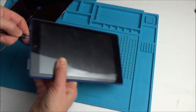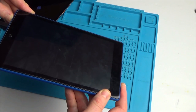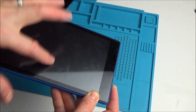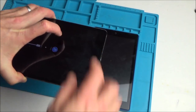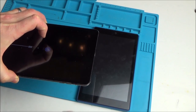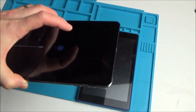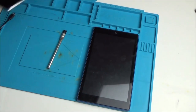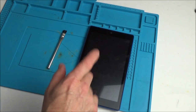Now you can see that battery symbol again on the Amazon tablet. I had a quick look online — right now it's not even showing the tiny battery icon, just the zig-zag lightning symbol, so I've got a feeling the battery's completely gone on this one. I did look online and this looks really hard to take off: you've got to heat all the way around the edge and pry it, with a good chance of smashing the digitiser. The LCD itself is glued down. This is going to be really hard to take apart. So I'm going to start with the Amazon tablet first.